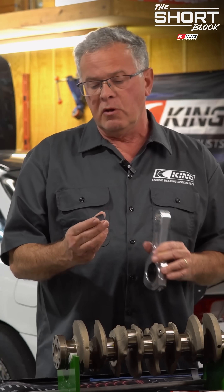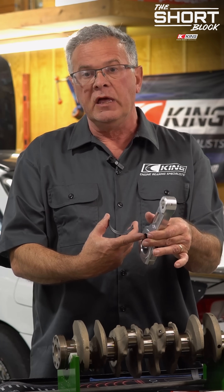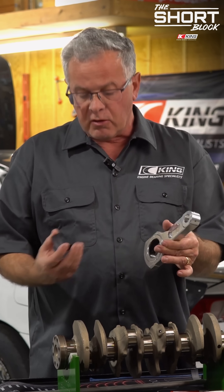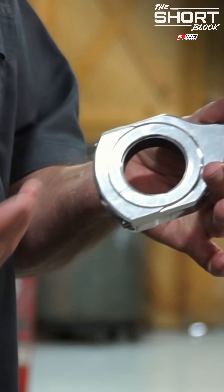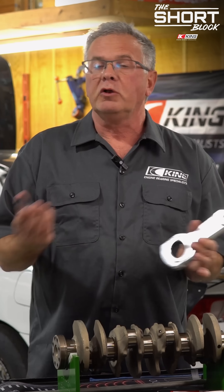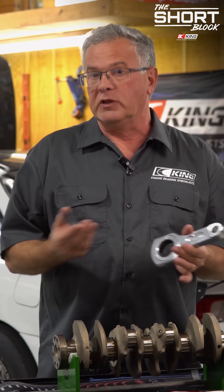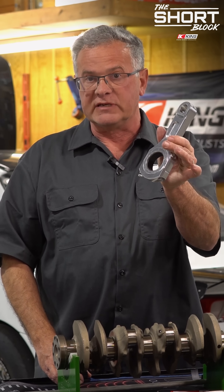The amount of oil that goes in here can dictate how much pressure is fed to this rod. That is very important. As you add more power to your engines, or just running length of time, the U-Groove and the dimensions of this carrying quantity of oil is very critical. Also, what oil clearances are you running? The more oil clearance you run, the more leakage you have. The more leakage you have, the more oil you need to feed through the crank to support your rod and keep it from seizing.